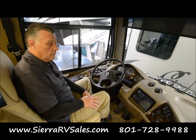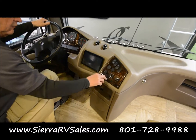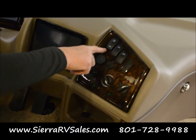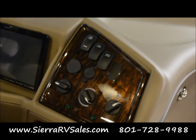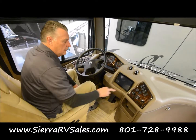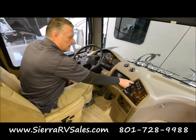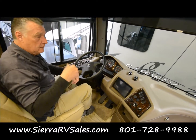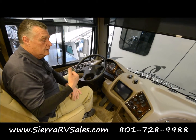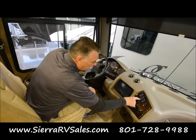The rest of the coach — if I'm driving down the road and the coach is hot and I want the air conditioning on, I'm going to need power from the generator to do that. I can turn the furnace on back here on the thermostat, but my air conditioning has got to have either the generator or electricity at a plug. So if you've got people riding back here and you want to keep it cool, then that generator is going to need to be running. Run the generator as long and as often as you want because it comforts everything. This is your generator start — hold this down until the light comes on and then push the top. The generator will start and stay lit, and then you can have air conditioning and run the microwave and do anything you need in the back. Without that generator, you can't run the air conditioner or the microwave at all — you can watch TV, but you can't do the other.